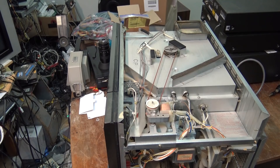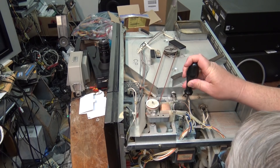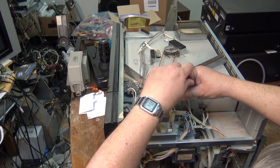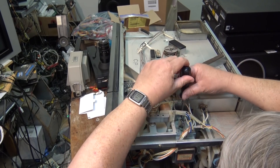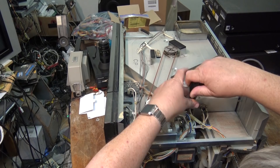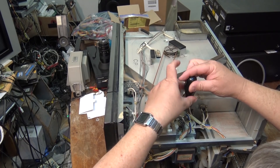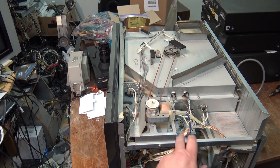So what we have to do to change this is I have to remove the thermal shutdown. This is a temperature sensor — it's a thermostat switch. So if the fan were to fail and the magnetron were to overheat, this would cut the power off. So we've got to take that off first. I gather you've rebuilt a couple of these before? Oh, I usually do hundreds of them. Hundreds and hundreds of them. When I was working down at the shop, because we did a lot of Panasonic repairs. Well, I think this is a Panasonic, is it? It's a Quasar — same thing. So let's get that switch out of there.